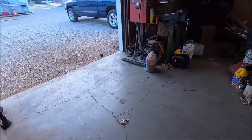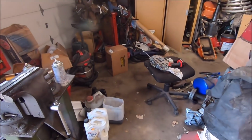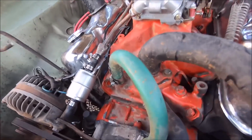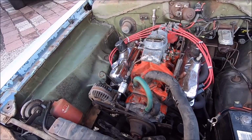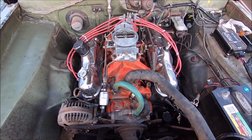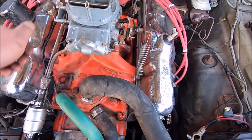All right, couple gaskets, throw that on there. Pray and hope to God. Oh, we got to change a bunch of them rubber hoses. All them rubber hoses were junk. Alrighty, so it's about 30 degrees. Carburetor's on. Redid a bunch of this crap. Trying to get rid of that loopy. It's gonna be kind of difficult. Got everything reset to factory set specs. Got the idle set a little high. Probably gonna leave this choke a little shut, and we'll see how it does.